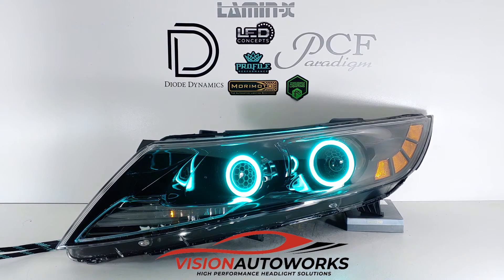Now all the wiring here we have pre-wired for him. Most of the wiring is internal to this headlight. So everything we have done — the bi-xenon function, the solenoids, the power to the ballast — all of that has been taken care of. There's going to be a little bit of wiring he needs to do on his own for the RGB products, but that's a given for any one of our packages. All LED accessories have to be wired in separately.